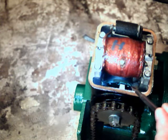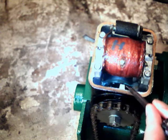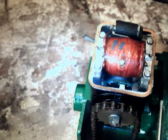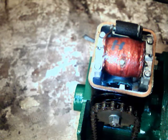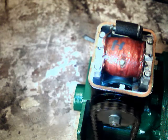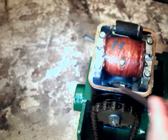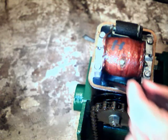What you've got to make sure is that at the moment the points are opening, this gap here is just in a vertical position — there's a gap that side and a gap this side, and the solid metal piece is at the top. Let's just move it again to the moment when the points just open, which is a few degrees before top dead centre. This is the point when the engine's actually firing, and you'll see that the metal piece is fully across the gap there.